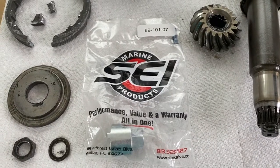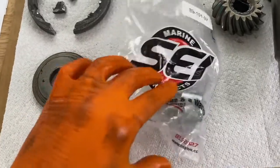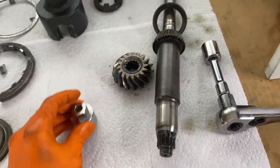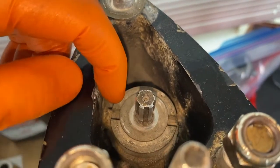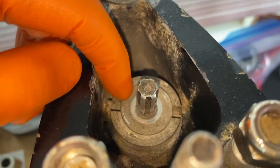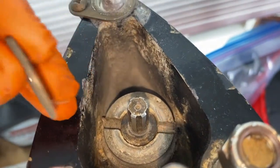Here it is — 89-101-07. Down below in the comment section as well as the description section is a link on where to purchase this. This is the shift shaft bushing — it didn't cost much. Here it is, very shiny. It's a three-quarter-inch size. We've got a three-quarter-inch socket into an extension into our ratchet. Back up top — this is the top portion of the shift shaft, basically the shift shaft bushing. You can see those two little cutouts — that is where the tool is going to slide in place, and those teeth on the tool will lock into the bushing and allow us to remove it. However, before that, we actually have to remove that washer down there, because with that washer installed you can't get the shift shaft tool into those grooves.